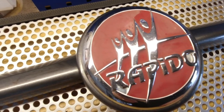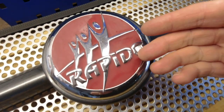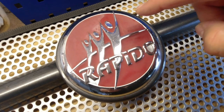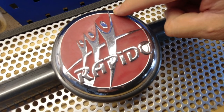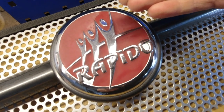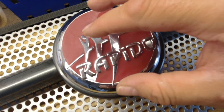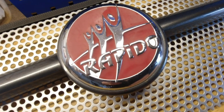My plan is to try and get the rest of the red out and then recolour it with red enamel. I could paint on top of this but that would give me two different levels, and also this is practically flush with the chrome. If I remove it, I think it's going to give me a nice well to fill up, so rather than paint around the detail I'm basically just pouring and spreading the enamel into a cavity - I think that's going to give a much neater, easier job.